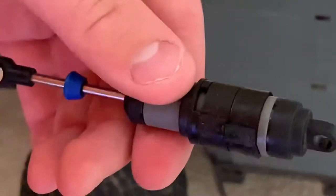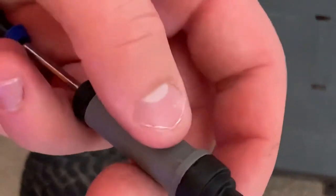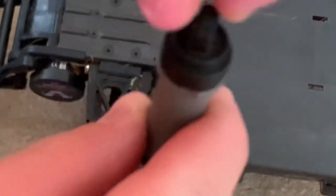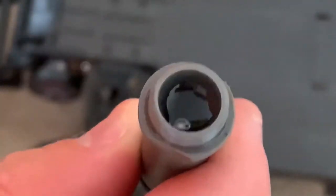All you have to do is unscrew this, but this part of my shock is really tight and I can't unscrew it with my fingers. So I'm going to take these plastic bits off — they just slide straight off — and then grip this bit here with the spanner. Once it's tight I'm just going to twist, and now it's loose. It just unscrews, and there's my shock cap. Lift that off — there's the oil.